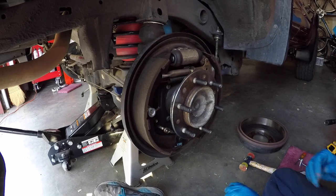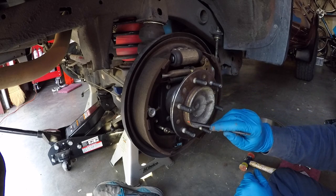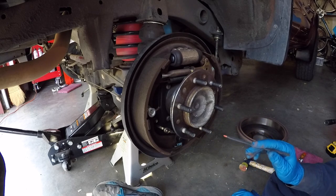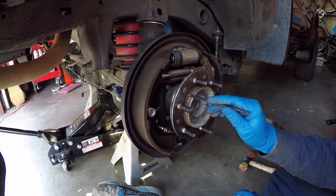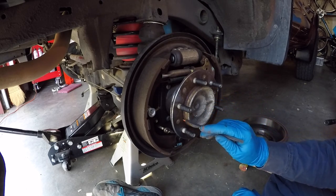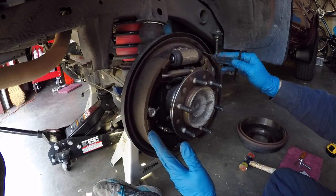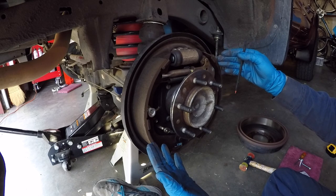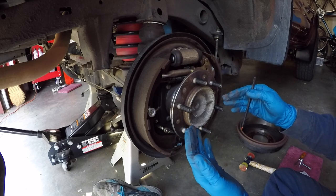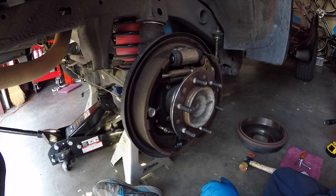This is the area where the brake drum can get really locked on — the drum contacts the axle in two spots. One of the steps we're going to do when we're all done is put a little bit of anti-seize in this area to limit the chance of the drum getting welded on. Because these rear brake shoes only do 25% of your braking power you don't have to change them that often, so anything you can do to make the next brake job easier is a good method.